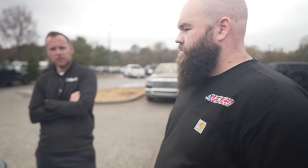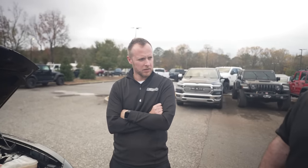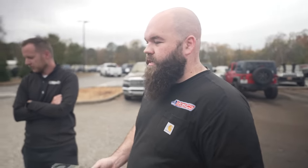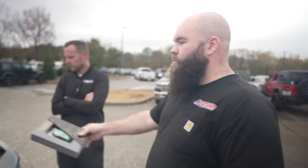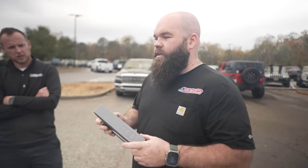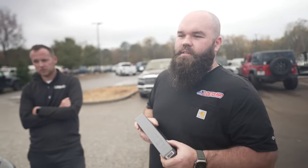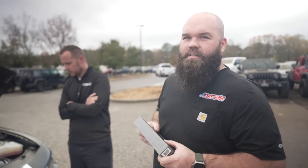On the Ghoul package, base Ghoul on 93, I would say low to mid 800s to the wheel, and 900 plus to the crank. Tim Barth's dyno does read lower because he's on new Dynojet software — you may dyno 850 on his dyno, but go down the street to another Dynojet and you may be high 800s. It's about 40 to 50 off. People shouldn't get too wrapped up in numbers — when you drive it, that's how you know how fast it really is.